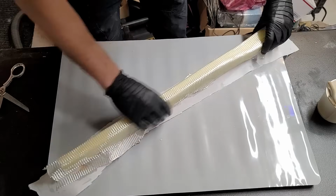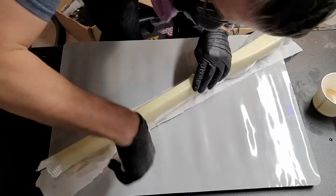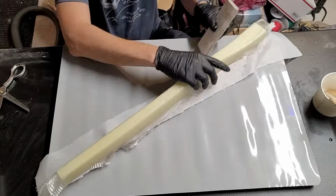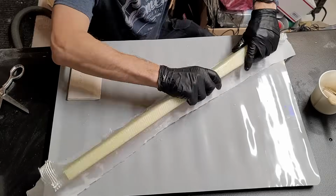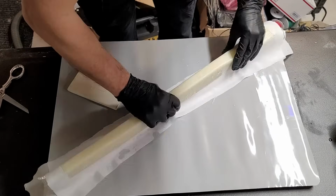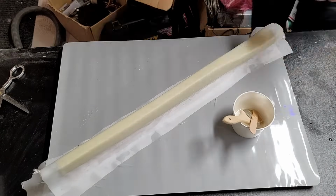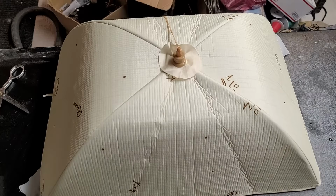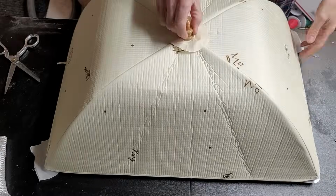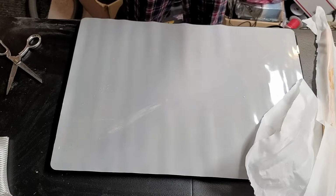One or the other. In any case, now that we've done the first 3 sides, now we're doing another 3 sides, which we'll end up with 2 layers of bid on the sides of the strut and 1 each on the front. But the whole idea is that this is now extremely strong. It's got this bid wrap laid up and epoxied in place around it to support the strut when it gets stressed and bent, and to prevent those fibers from separating apart.